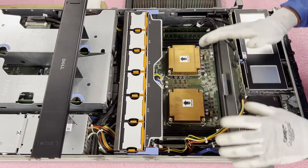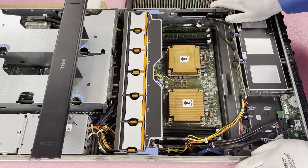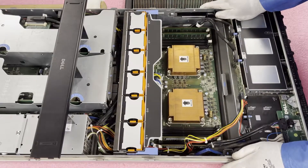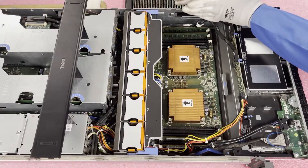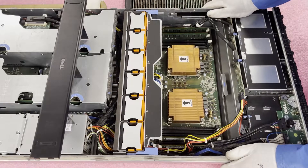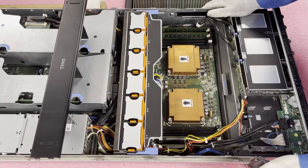If you have a more low-end system and only wanted to put in four or six modules, the way they have it configured is actually perfect for four modules, assuming you have dual CPUs. If you were going to put in six modules, the next slots you would want to put them in would be the two white slots. People ask why we skip over the black slots — it's about having a proper balance for your load. If you put them in the first three slots, you've overloaded the first channel and you're getting nothing out of the third channel. You want an even amount per channel. I'd always recommend putting in either six or twelve so you can utilize that third memory channel.